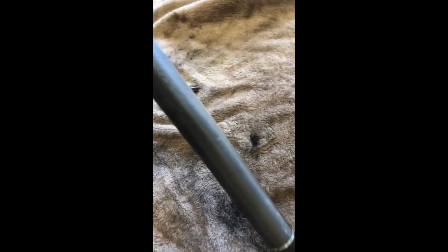And there's an actual magnet inside of it for the metal. So we'll show that when we go to clean it up. So that's it as far as getting that out at this point. Alright, so this is the housing, and then this is your screen. And it's hard to see in here, but there's actually little metal shavings. Okay, you see a little bit better right there.